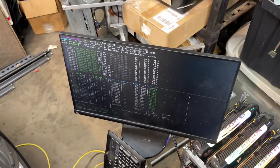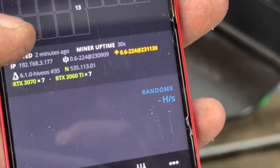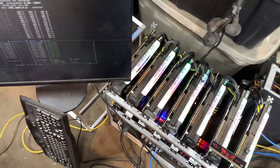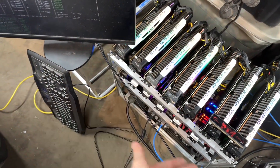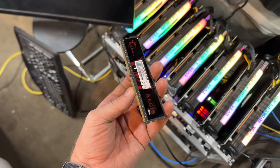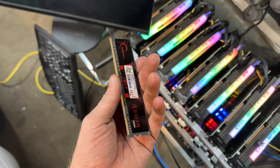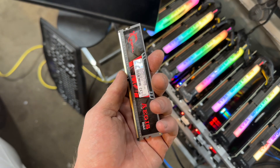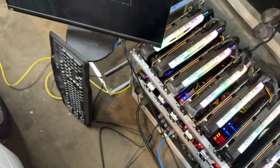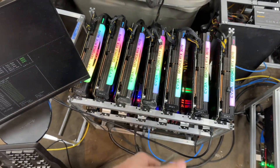Everything is good. I've moved it over to the SSD now and upgraded the drivers — we're on 535.113.01. I have not gone all the way to 545 with this. I have no idea why the original motherboard cleared its own BIOS and then refused to boot. The replacement board I had in the basement posted just fine, but I need to do more intricate testing in the future because it booted fine but had problems when I ran commands. I've been having similar issues with the new OctoMiner. I might rip out that four-gigabyte DIMM and just run the eight gig. Anyway, this rig is good to go. Thanks for watching, guys.